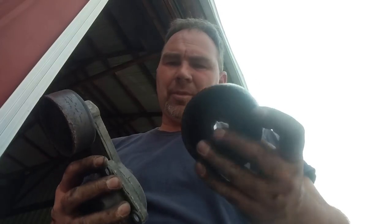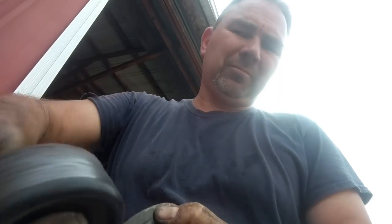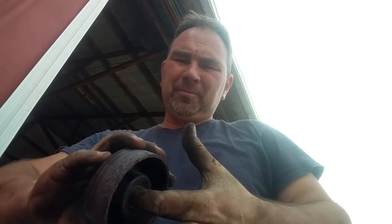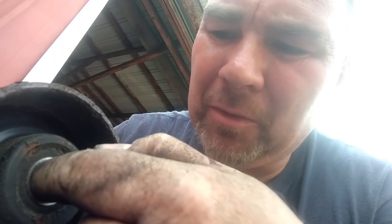Some things just never change — you take it apart, check bearings. We'll be replacing that one. This one sounds okay, but I can feel almost every bearing when it spins, so this one isn't long for the world either. We'll order both of these up. More than likely I'll just replace the bearing because this tensioner felt really good — unless the assembly isn't much more money, then I'll replace the whole thing.